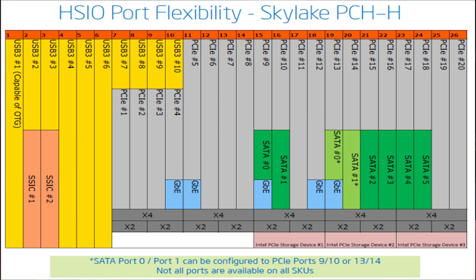In terms of layout, there are still 16 PCI Express lanes directly connected to the CPU. The other PCIe lanes go through the Z170 chipset, which has much better connectivity via the DMI 3.0 interface — probably laying the foundation for whatever comes next in PCIe for the enthusiast Socket 2011 platform. Because of the FIVR changes and the new DMI 3.0 motherboard layout, you need a new motherboard, new socket, and new chipset.